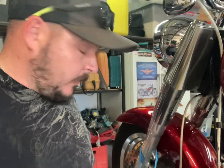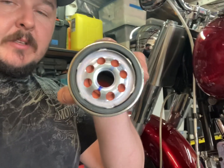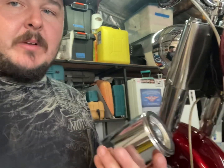I'm not going to video the change of this because it's just too hard to get an angle on it, but I will top up the new oil filter and rub a bit of oil around the seal. Just remember, these don't need to go on dead tight — they just need to go on with good hand-strength tight, not too tight, because you want to be able to get it off again in the future.